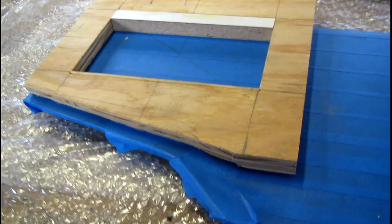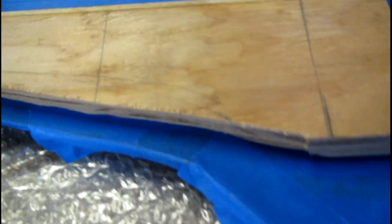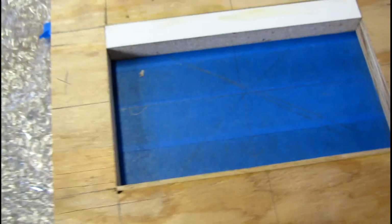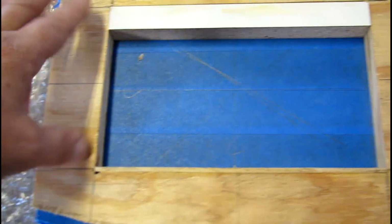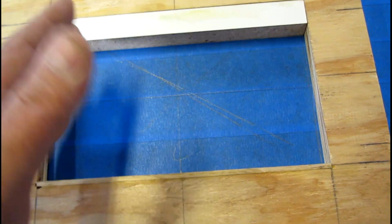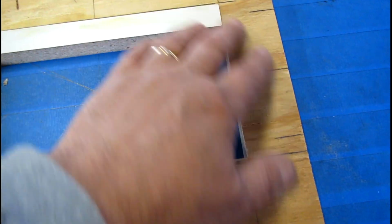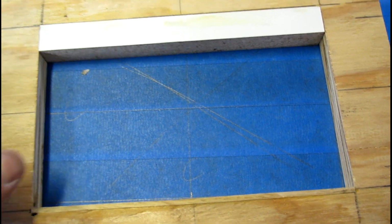Hey there. This is a template. It's been modified, beveled the back edge of it a little bit to accommodate the flare on the plastic panel, so it'll lay pretty flat. So I'll just have to use a few pieces of double stick tape, stick it right down, then I'll flip it over, and I'll route it so there's no chance of any abrasion from anything rubbing on it. It'll rub on this. And the router will just follow this and cut out a beautiful window.